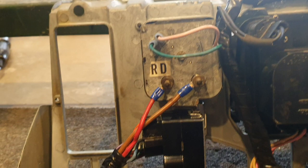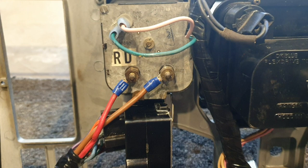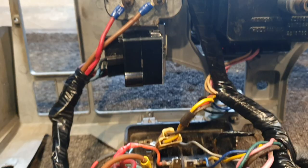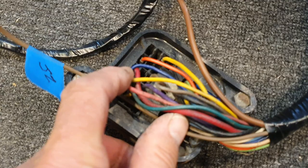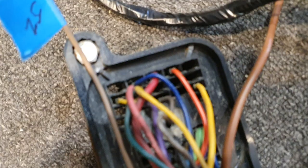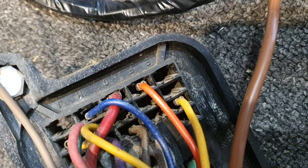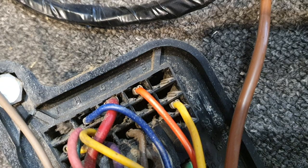The only major difference, which was a little confusing at first, was the ammeter. For it to work properly you've got to use four millimetre cable, because it's coming directly off the battery. There's a wire here — GZ — that big red one that basically comes from your starter motor or the solenoid. I'll show you that in the wiring diagram in a minute.